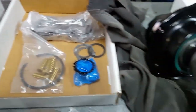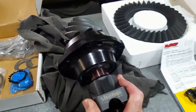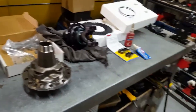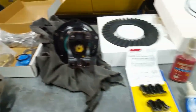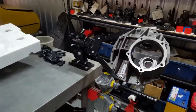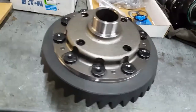Got our spigot bearing ready to go, pinion set up and it's come up very nicely. I'm just plugging away — I'll get the ring gear installed, bearings pressed, and then start dummying everything up. Just a quick recap of what we're doing on the Reaper Charger nine inch build.